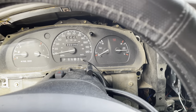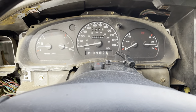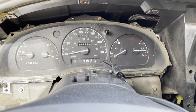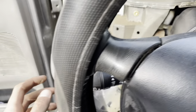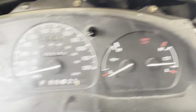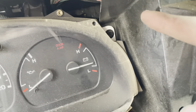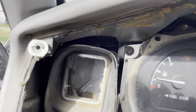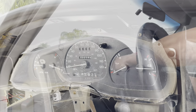I was able to get it out by turning the key on — not actually starting the truck — and then shifting all the way down to first, with the parking brake on. Once you get that piece out you can adjust it. There are four bolts holding in the gauge cluster, one on each corner, and they are 7mm. Go ahead and remove those four bolts.